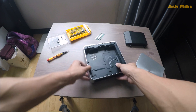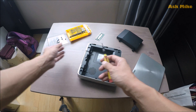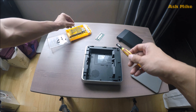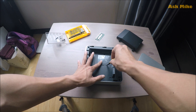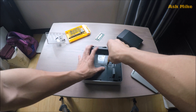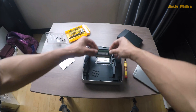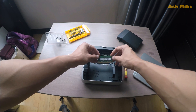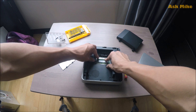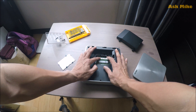The second step is to put in the memory. Let's open the cover for the memory — the screw size seems not suitable, so let's change to another one. It's a bit tight, so let's unscrew further. Now just put the RAM into the slot — there are two slots here. Slot in the memory and make sure it's properly inserted. Okay, I think it's done this time.